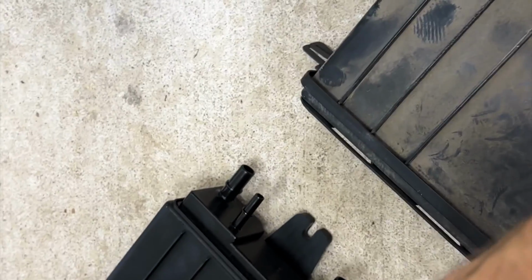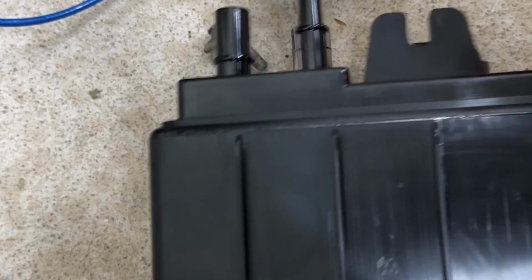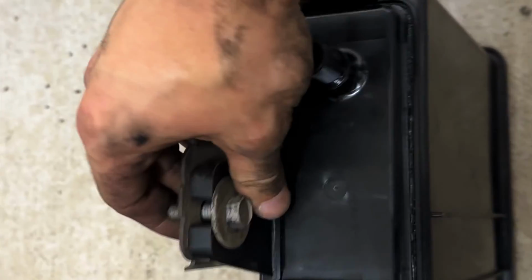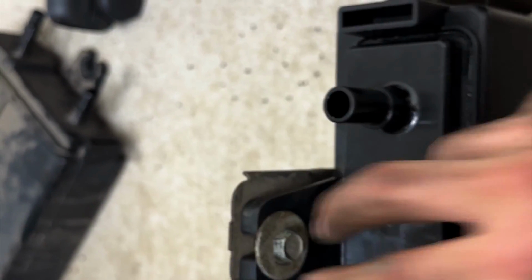What you do now is move this bolt, add the bracket to the new part. Listen to this. Oh, you know it's bad when it's spilling out charcoal, which could be a very bad sign if it's clogging the lines. And of course, you know, that's not happening here. So you can start this bolt with this kind of pulled out a little bit, then start it and start tightening it, and it should line up perfectly. This did look a little big at first on the bracket, but now it fits perfectly once I kind of wedged the bolt in.